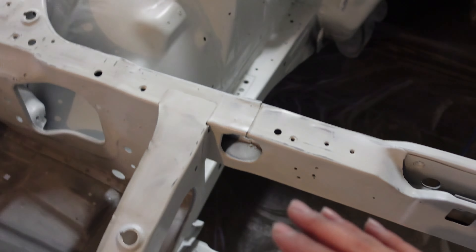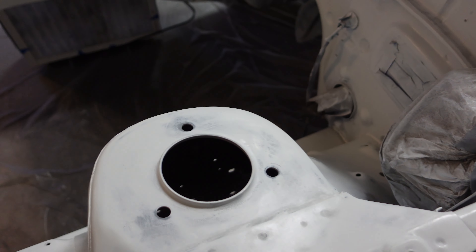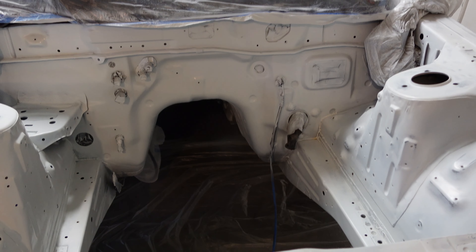I'm going to run my hand over everything here to check for rough spots, especially on the top parts that will be most visible. I used some isopropyl alcohol to clean the initial residue off, but it actually took off a fair bit of paint in spots where the coat was thinner. If you use isopropyl alcohol, be careful — use a damp rag rather than a wet spot, otherwise you risk removing your paint. I went over the rest and didn't notice any more coming off, but just be mindful of that.